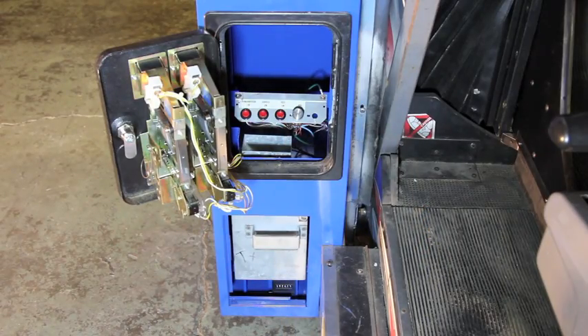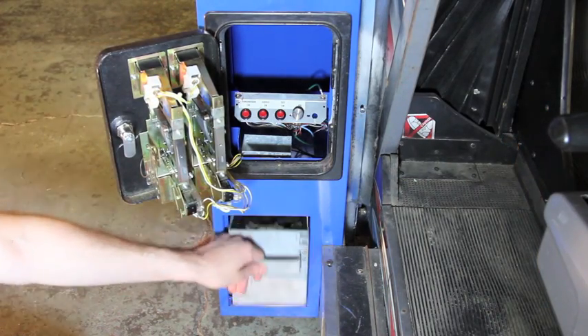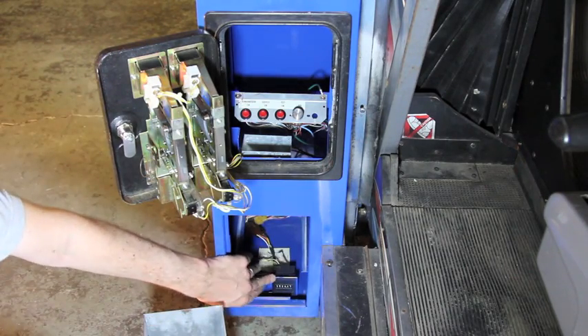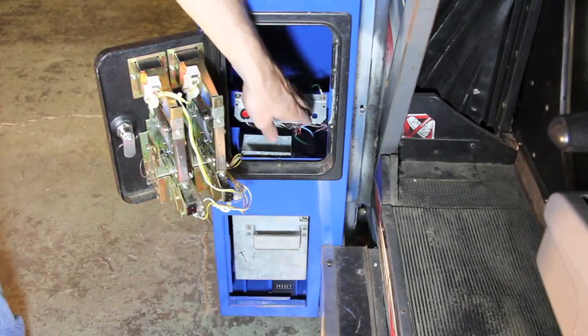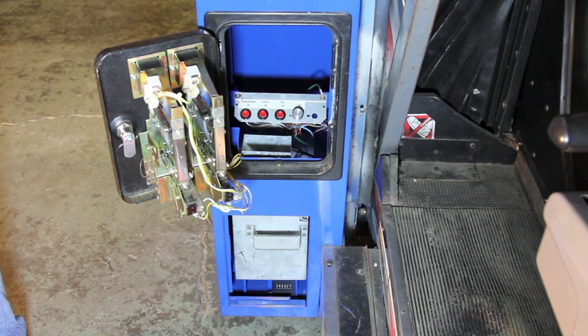Now here we're inside the coin tower. Here are your coin mechs. The bottom has a bucket to pull out for your quarters. Underneath that is a coin counter — I've got an empty slot in mine but there's space for two coin counters. And then here you have all of your game controls: there's a volume switch, a test switch, a service switch, and the demagnetizer switch which is a degauss for the screen. The test switch and the service switch — one adds credits and the other puts you in a test mode for the game.